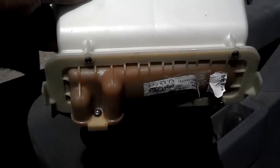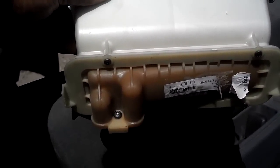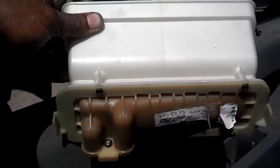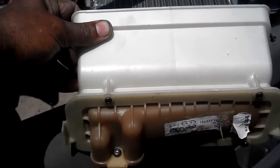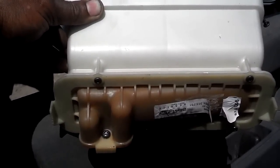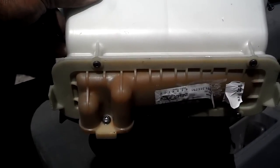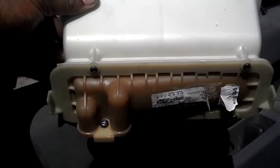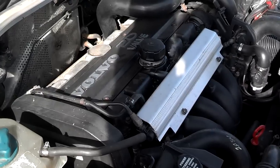There's information in the comments below to direct you in changing this heater core. What happens is the seal in the seams starts to loosen, or this plastic piece on the bottom could have a total failure — split open and spill out all of the coolant in the car in a matter of a couple of minutes. The heating system in these Volvos is a full-flow heating system, and you cannot cut the coolant flow off to the heater cores. So if you select full cold, hot coolant is still flowing through this heater core. If it leaks or breaks, you'll lose all your coolant and overheat your motor. I would say 7 out of 10 Volvos in the salvage yard are there because of motors overheating, and many of those are because of heater core leaks and failures.